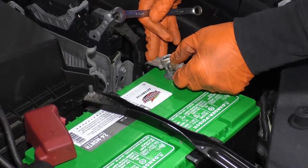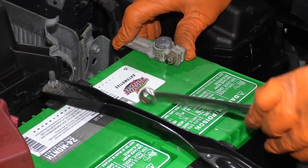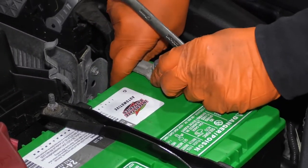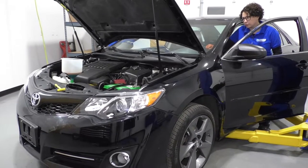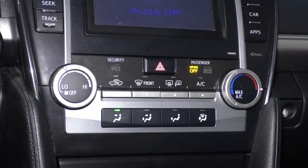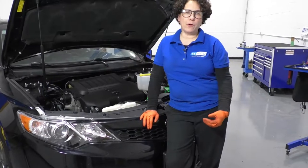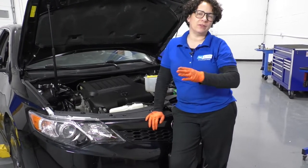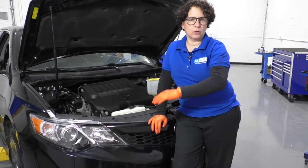To re-hook up your negative battery cable, just bring it right over the post. Make sure it goes down all the way — hold it firmly and add a 10mm wrench, just tighten it up. Good to go. So now we're ready to run our vehicle and let the coolant burp in the overflow fill tank — it's a coolant burping tool. You're going to want to run this with the heat on max and vent with the AC off. You can turn the blower on just a little if you want. We just want to make sure that the hot coolant circulates through the heater core so you get the proper level. After about 45 to 50 minutes, that should be full temperature for this car. Just make sure you hear the coolant fans come on because the cooling fans coming on is a good indication that the PCM is getting the proper signal from the ECT sensor, that your thermostat's working and the coolant's full.